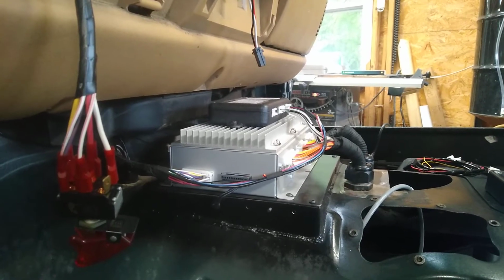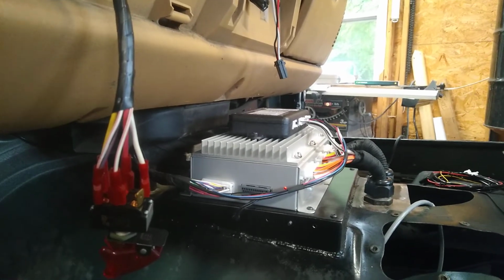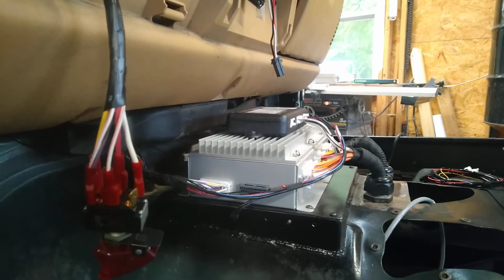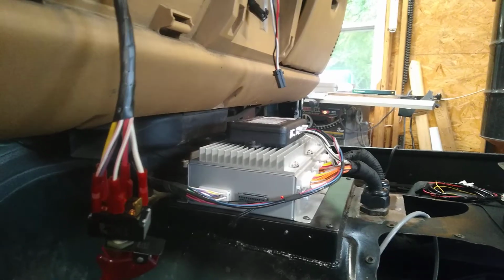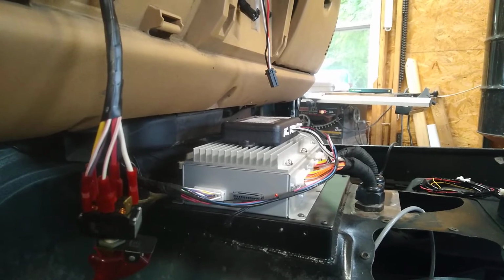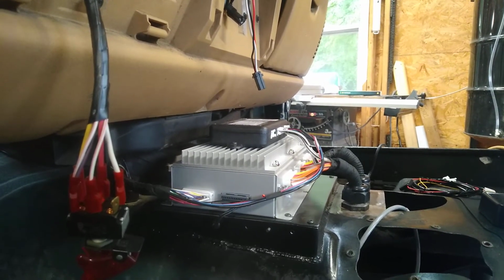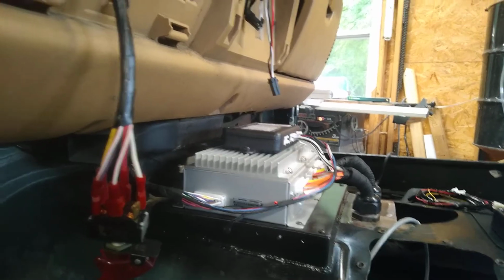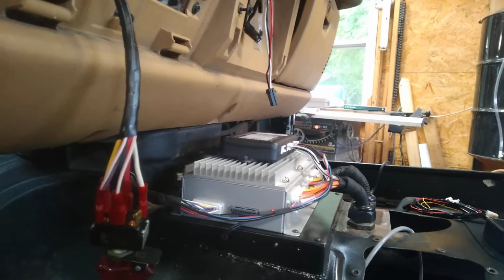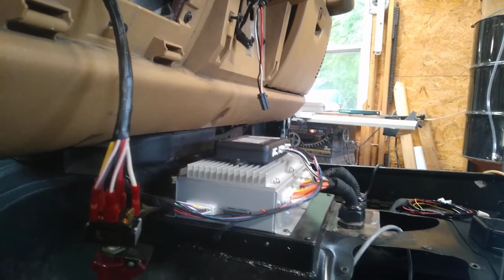Then the next time, after I unplugged it after supper and plugged it back in, it wouldn't come on at all. So now I've just got it unplugged, so I don't have any thermistor readings at all. I'm not worried about it right now. I'm only charging at 8 amps. Each module is only getting 8 amps, each cell. So it's not even breathing heavy, so I'm not worried about that at all. I would be worried about that when I start driving this thing, especially on a hot day. Yeah, so I need to sort that out. I think maybe that thermistor module is bad, but I don't know. We'll see. Hopefully I didn't wire the thermistors themselves wrong, because that'd be horrible. That'd be tragic. I don't want to talk about what I'd have to do.